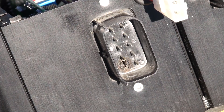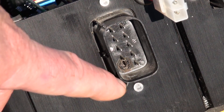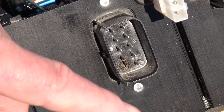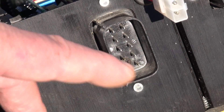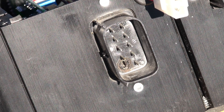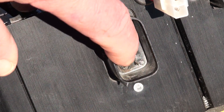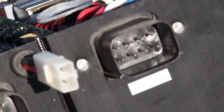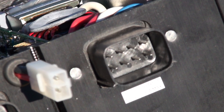My red wire down here is the one that's actually burnt and gone on the bottom. I'm going to start by cutting on the other side — I think it's a purple-red on the other side. I'm going to hook it up to the red wire here and see if just bypassing that one wire works. Maybe all these other terminals are actually good — they look good on the other side of the plug. But you can see how small those plugs are.